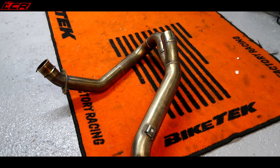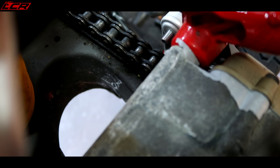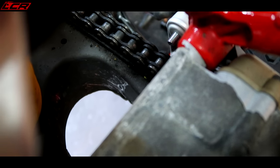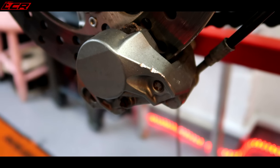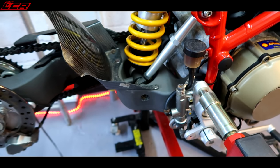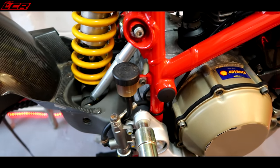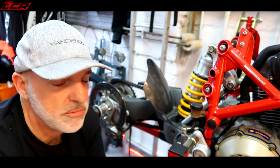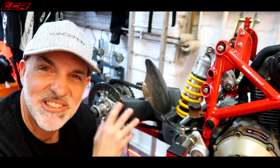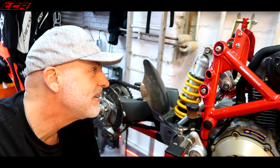But in the process of getting it out I've scratched the inside of the swinging arm quite badly, which I'm annoyed about. And the rear of the exhaust was also notching into the rear caliper and put some marks in the rear caliper. Not the cleverest — not my finest moment getting that out, trying to do stuff without stripping it down properly. Always try and take stuff apart on the bike — it's much easier to get this stuff apart on the bike than when it's part-removed. Lesson to be learnt there. That's the exhaust off. It's nothing more annoying when you're actually damaging the bike as part of your restoration.